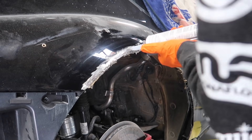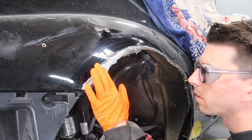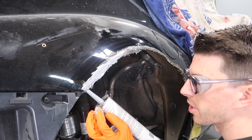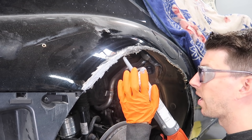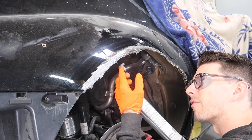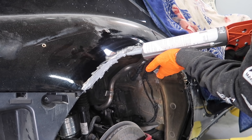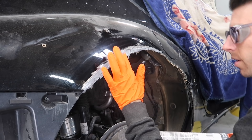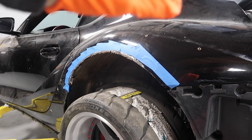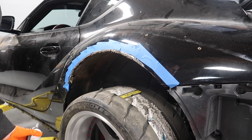Now we've got some seam sealer and we're going to lay our bead and make this look nice. The purpose of this is to make it look flush and keep out all the debris underneath the body kit. Even though it's tacked, we still have some gaps between some of the edges, so applying the seam sealer will create a seal to protect it from the elements getting inside the car. We're going to lay a base layer, put some cake on the car, then go back a second time for any crevices. We should have thought of this earlier, but we taped off the edges so when we remove the tape it will be cleaner — got that tip from Throttle, so shout out to those boys.